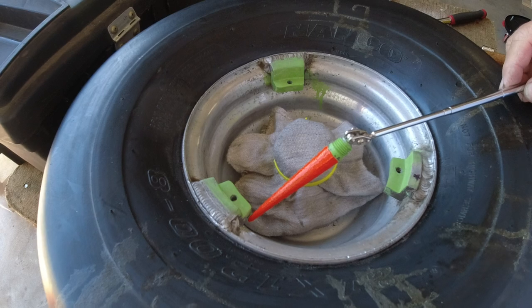I had some difficulties installing these new Matco brake pad assemblies. First, when I got everything together and put the wheel on, it was binding. It turns out the tangs on the wheel that the disc brake attaches to were hitting the brake shoe right here. So I put the brake shoe assembly to the grinder and ground off the corners — problem solved.